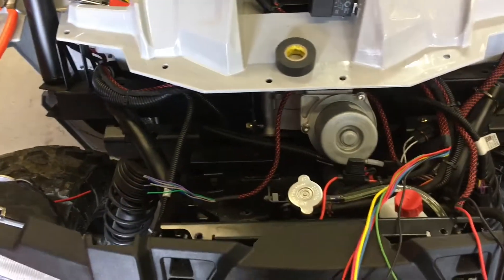For the radiator fan, it's going to be pretty simple. The radiator fan plugs in at the bottom. I'll unplug it and use two WeatherPack connections since that's all that's there, and build a plug-and-play splice. That way I don't have to cut the factory harness. The splice will tee in my switch connection for the fan override.